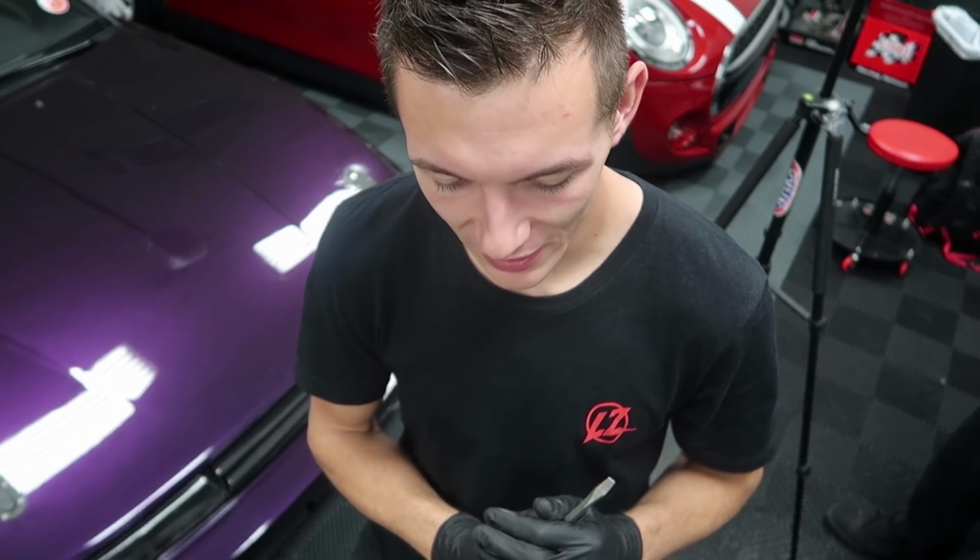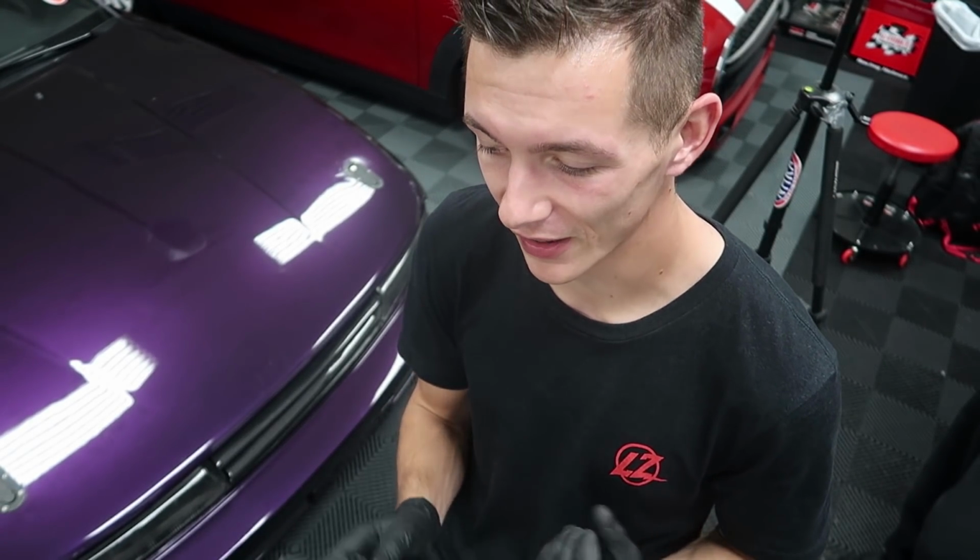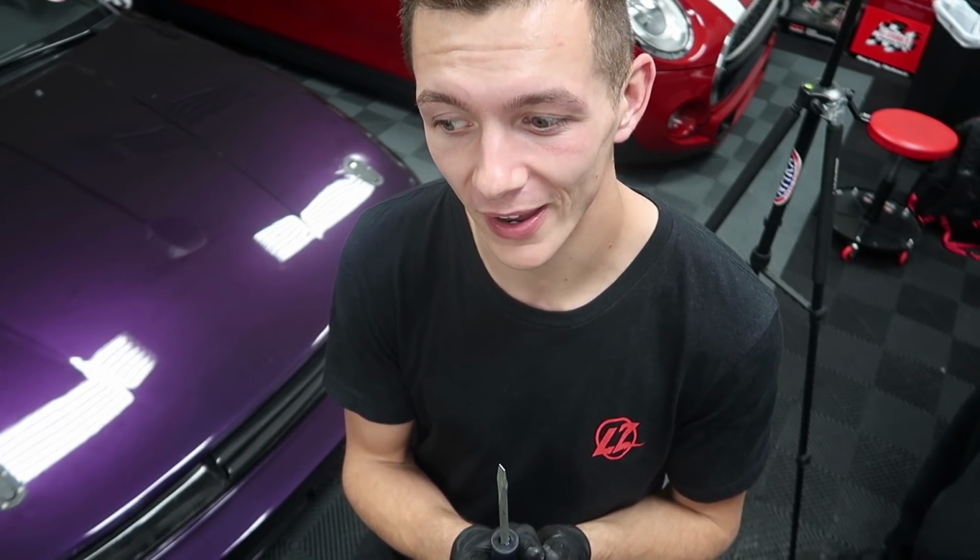Yes, sometimes an LSD is better for driving around town and stuff, but the 350Zs come with a VLSD, and for drifting, they're very inconsistent. I used to have one in my 240. They don't really lock up all the time, and you know, you don't want to go to drift and then have one wheel spinning and your car straighten out and go into a wall or something.